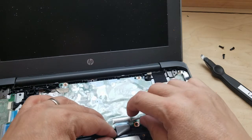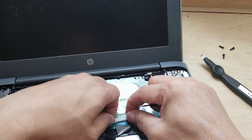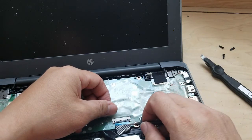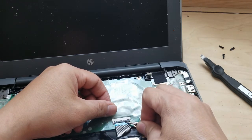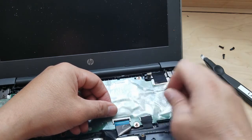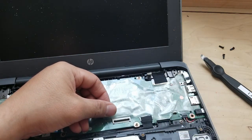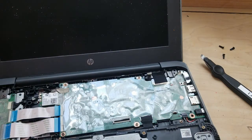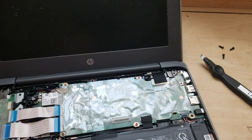Same thing goes for the other side — lift up the plastic tape that's holding it down so it won't detach accidentally. There's also a plastic clip you want to pop up first. Slowly pop it up, don't yank the cable out. Then use the tweezer to pull it out — it comes off. There are two connections total. I'll pause while I bring the replacement Chromebook that has a good keyboard.